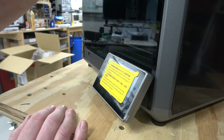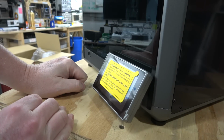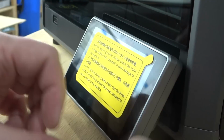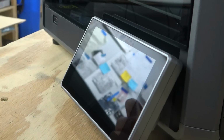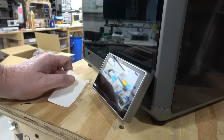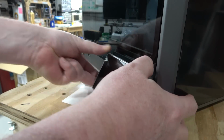Yeah, sometimes I can take umbrage with that. Because in the case of this, there's a fairly thin ribbon cable connector. And if you were forcing this and you slipped, you'd smash it down that way, and that could break the cable. So I would say the attachment of the screen, they should make it so it requires less force, just so it reduces the chance of accidents. Because that's what happens. Like when I sliced open my thumb, when you're putting a lot of force into something and you're having to put too much force into it and then you slip, that's when you hurt yourself. Or in the case of this, you might damage the ribbon cable.